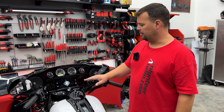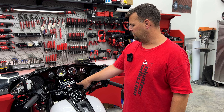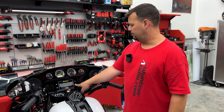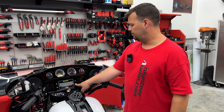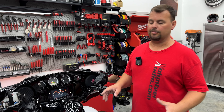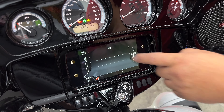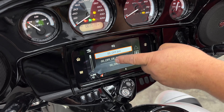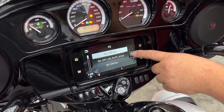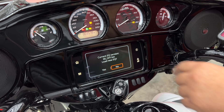It's powering up. As soon as we get to the accept screen, hold the power/mute button down. It's popped up — just continue to hold it until it brings up a service menu in the back side of the radio. Now we see the service menu. Select Audio on screen. From that point, click EQ. You'll see a list of different EQ BIN numbers — none of this matters, these are all the available ones. Hit the Info button and that's going to display the current one in your bike. The current one in this bike is 00off.bin.